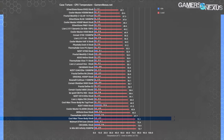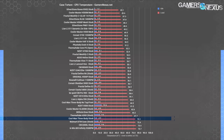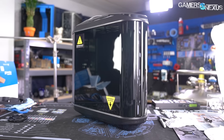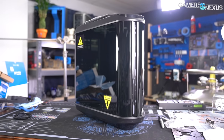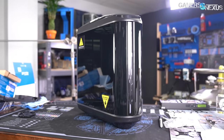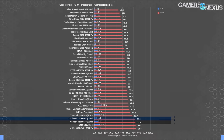Compared to other cases on our chart, the 3-Body's stock temperatures are abysmal. Even the best configuration — with top and front panels removed — only puts it on par with the Lian Li Alpha 550, though it's a good indicator of what could have been. If the plastic side panels didn't extend all the way around the front corner, leaving an area of mesh exposed at the front, the two 120mm fans would do a much better job. Giving the bottom more spacing from the table would also help. The stock case is about the same as the Walmart case for thermals — one of the worst we've tested.